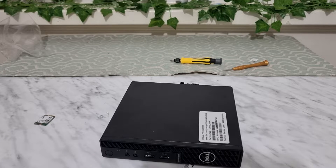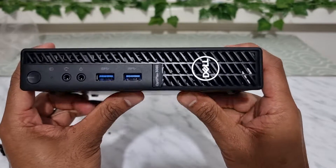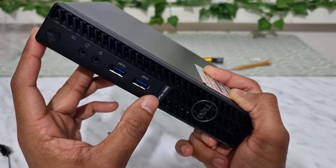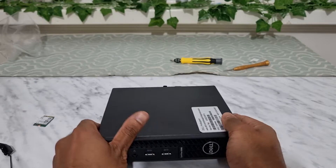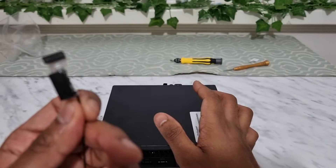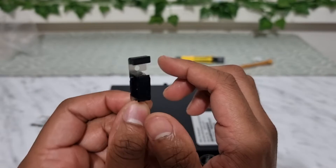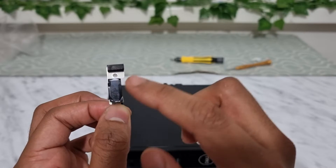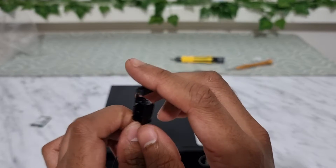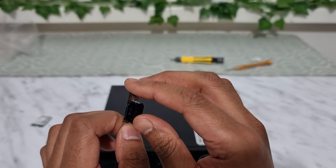Hello, welcome. In this video I'm going to show you how you can install Wi-Fi kits — the Wi-Fi and Bluetooth kits — in one of these Dell Optiplex machines. This process applies to any Dell Optiplex machine, all the way from Intel 4th generation. The placement of the antennas and everything else is the same. From 10th generation onwards, this internal antenna is slightly different — slightly beefier — than the older models, but the process is the same.